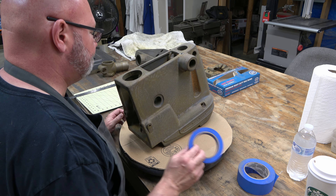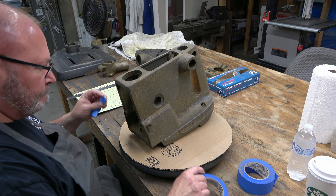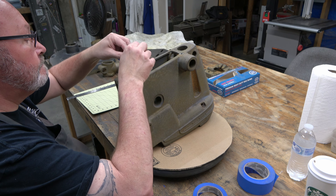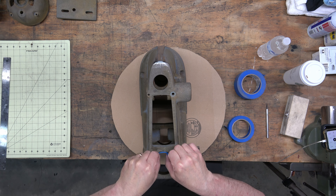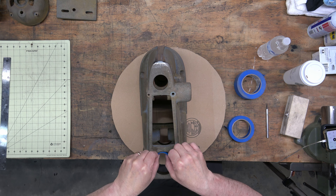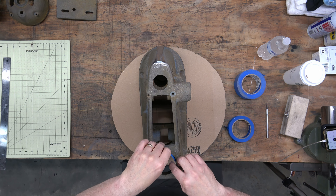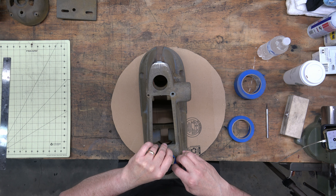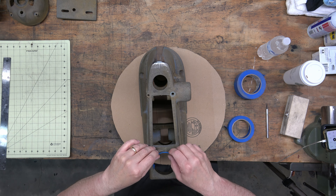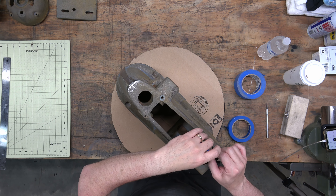The first thing I'm going to be doing is masking the head unit or the head casting. Sometimes I will go ahead and clean these bores out with a bottle brush ahead of time, and sometimes I'll wait until the painting is done and then do it then. That way I can remove any primer or paint that may have gotten under the masking tape, because that happens every once in a while. In this case, I'm going to do all the bore cleaning after the fact.